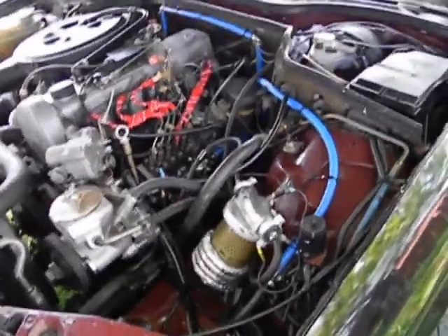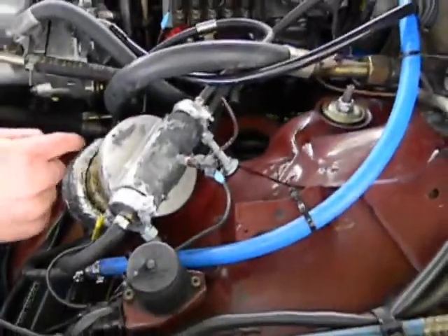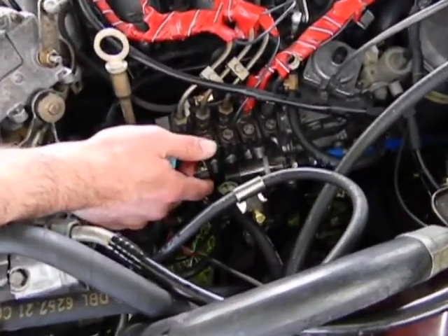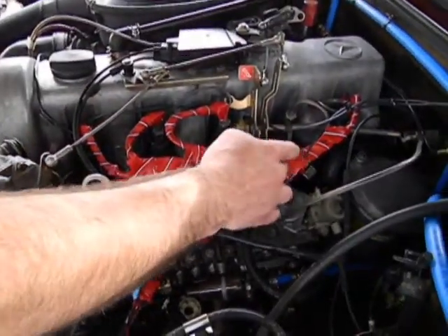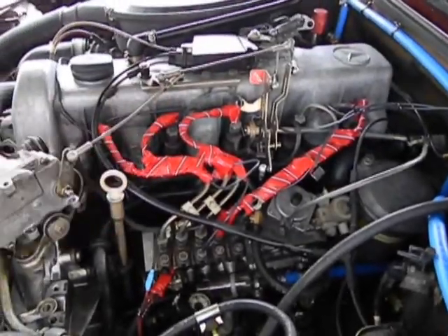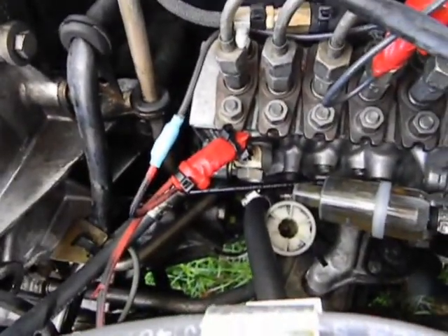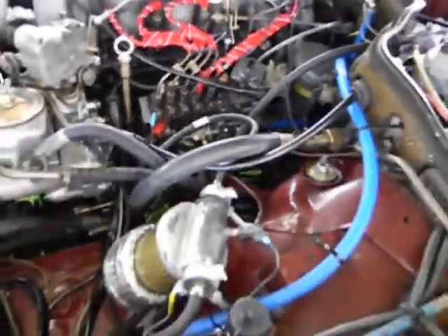Kind of like a Golden Rod, yeah. And then we heat-lined it — from right in here it goes through into the middle of the fuel line, then through here it heats up this metal part of the fuel line, which is brake line retrofitted. And then wrapped it up with insulation and built the actual heat lines for this model — for the fuel filter and fuel lines — and those are from Noah Young, who does an awesome job. They really get hot. And right down here at the break where it enters the injection pump — because this is not a two-tank system, this is a single tank — we've got everything up and running how we want it.